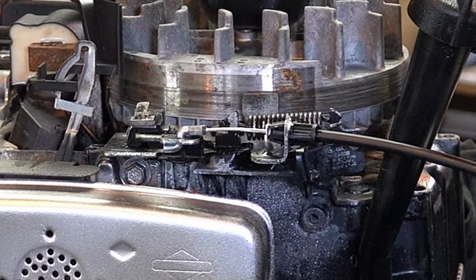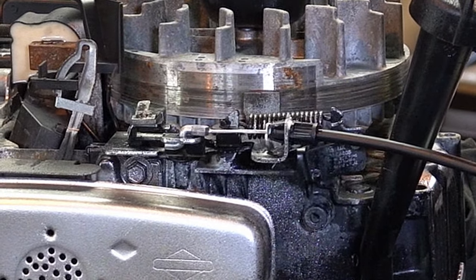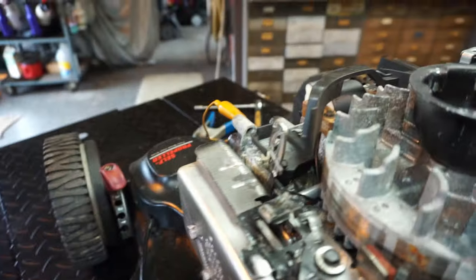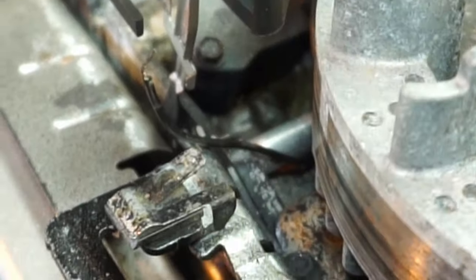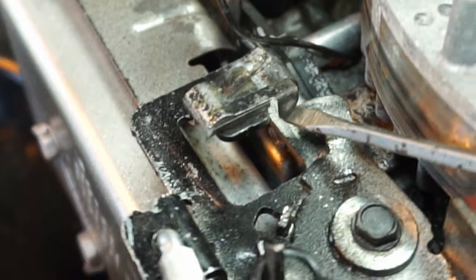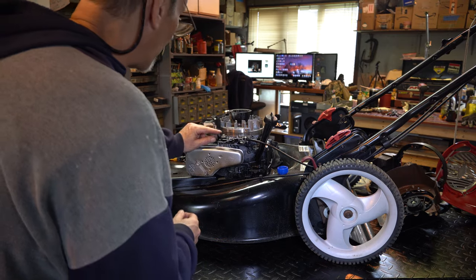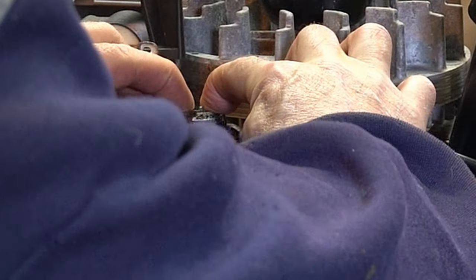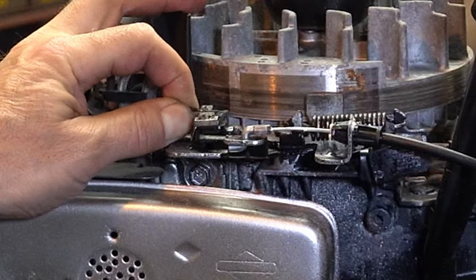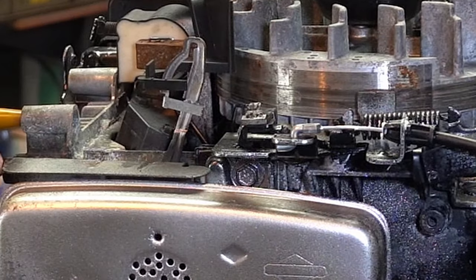It feels a little better — and it clears! Look how much further back it goes now compared to before — way further back. I'm trying to hold the bail so you can see it. I can now get my screwdriver in there easily. Let's hook the coil wire back in — just press it down and slide the wire back into the hole. Go back and forth a little to make good contact. A lot of times they'll just give it a bend and that's it.